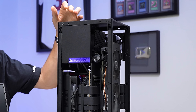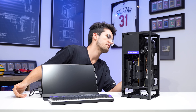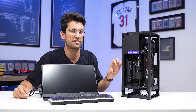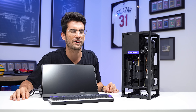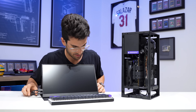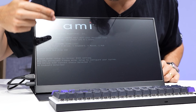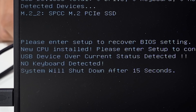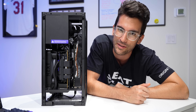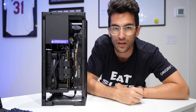Here we go, powering on. All right, so that's a good start. I think all the fans are spinning, including this one little case fan at the back of the H1. It's important to note this is the V2, so this has the revised riser cable, which apparently doesn't catch fire. So that's nice. We are waiting for a POST here any second now. There we go. All right, so that looks healthy. And it goes right to this, where it again tells us that we have an overcurrent status detected. And true to its word, after 15 seconds, the system promptly shuts down. Now I can fire it back up again, but it's going to repeat this over and over, and this is why the owner was getting frustrated with the rig.